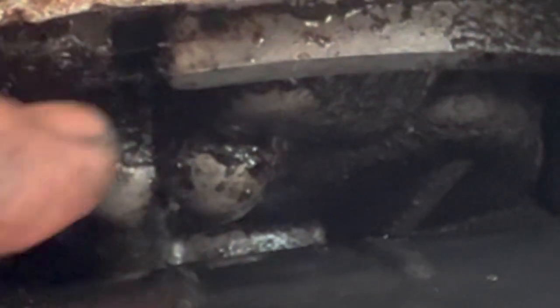There are two slots on your transmission — see those slots on the edge? Those actually go into your pump. Right now it's straight metal on metal. So you want an eighth inch of play on those tabs, because it's pretty much just some gears meshing together. An eighth inch keeps the balance of the pump centered on those gears. If you just bolted it down flat, it offsets those slots on those gears and they'll wear grooves in your pump. That eighth of an inch actually centers your torque converter on those gears so it rides evenly and won't wear out your pump.